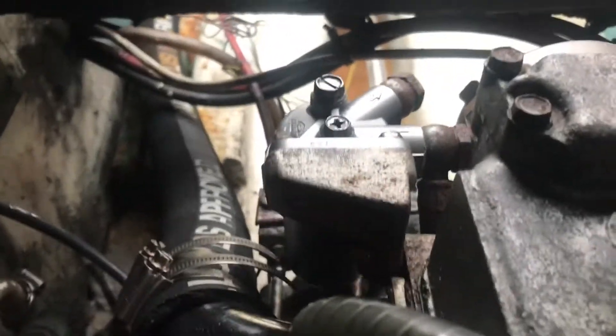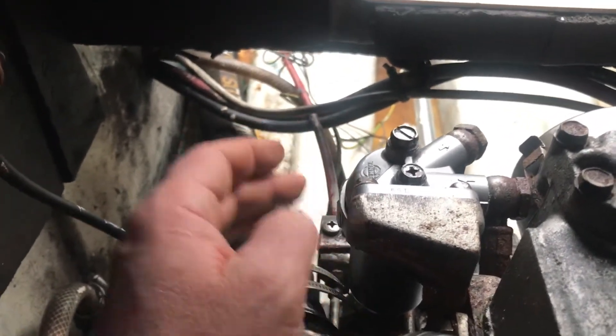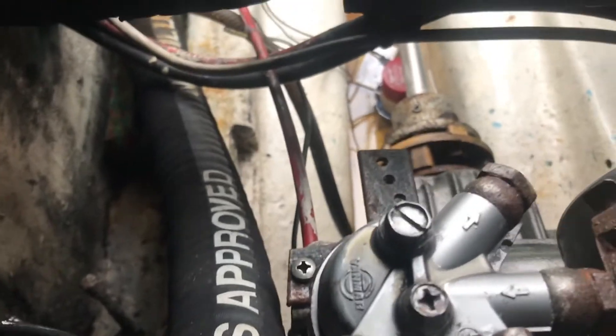I can't see anything coming out yet — I could see bubbles a minute ago. That took ages, about three or four minutes. The reason being, of course, that I replaced the fuel filter and inevitably there was a big air gap I had to fill up. But now I've got to the point where I start pumping and you can see fuel coming out.